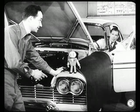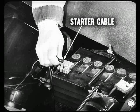These headlamps almost black out. Guess there's high resistance or maybe battery trouble, right? Ordinarily we'd check the battery first, but this acts more like high resistance. So let's look at the cable connections. Feel how loose this starter cable is? And yet it looked tight.